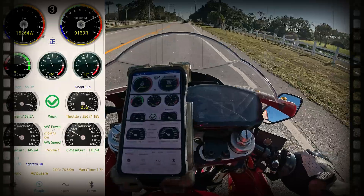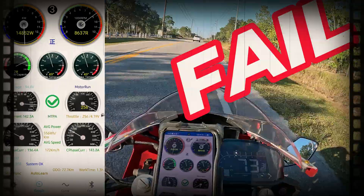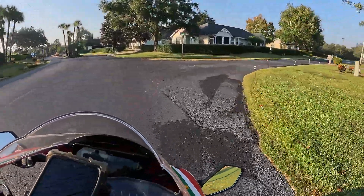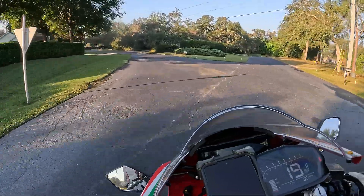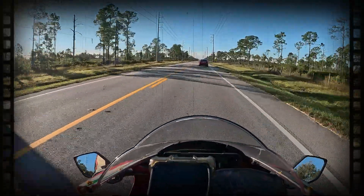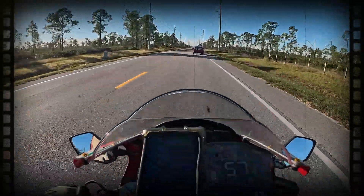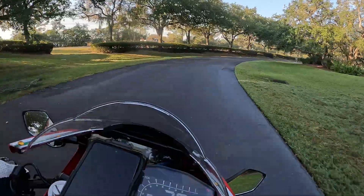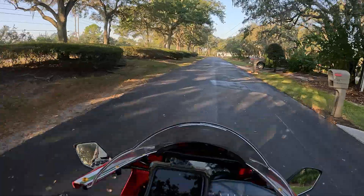But I got to my rated speed and we still didn't enter field weakening — 77 miles an hour, it is not increasing at all. Everyone gave me comments and told me why. The second law of thermodynamics tells us we're going to waste some energy. When we make that conversion to reduce torque and increase RPM, we're going to waste some of that energy. Nothing is free. I'm expecting to enter field weakening and increase speed — that's an increase in energy.